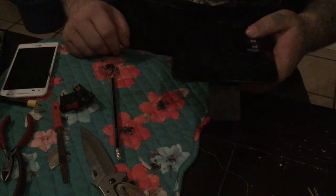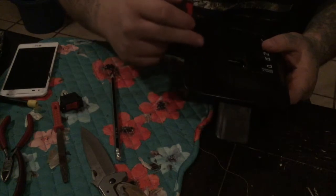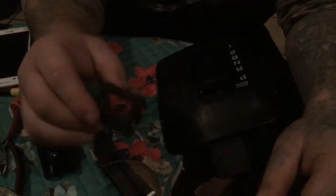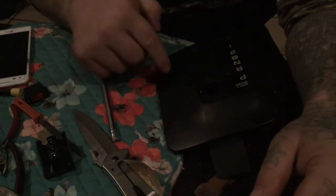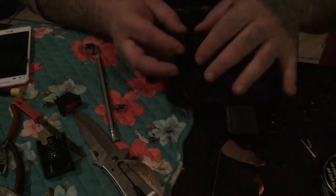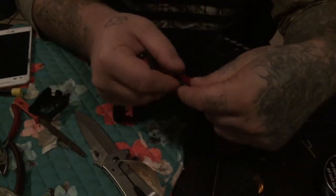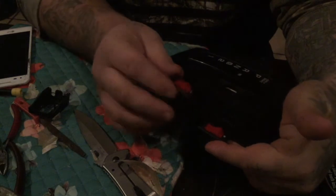Here I've got the bezel cover for the shifter. All I'll be doing is cutting out a couple of square holes to mount these toggle switches down into. I'll be taking these plastic mounts that come with my switches and use the inside hole on these to mark out the location and size that I need to cut out of the shift bezel. I'll sit these beside to get a rough idea of the position.